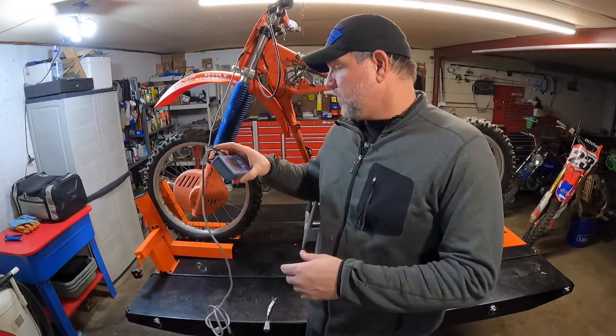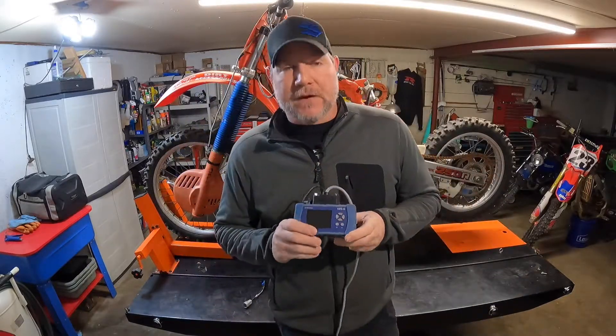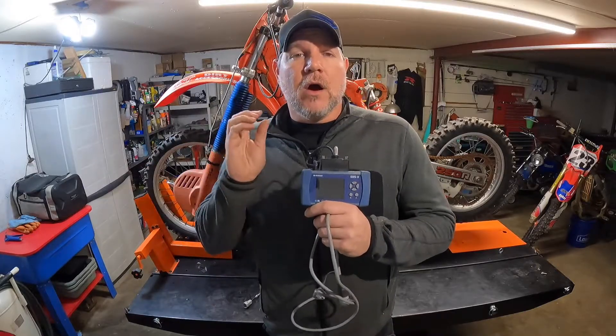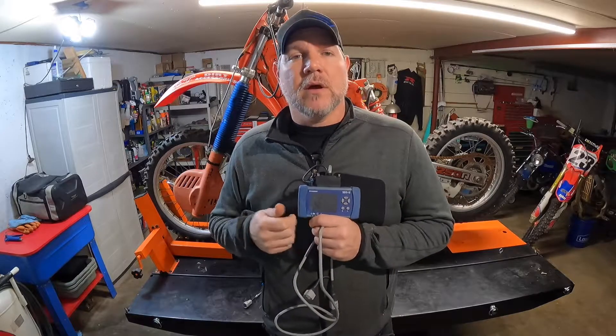Right now what I have is what is actually called the SDS2. This comes from a good friend of mine who let me shoot this video — they're a Suzuki shop out in California. Basically this tool is your factory Suzuki tool where you plug in, put the VIN numbers in, you can data stream, download your data from a known good unit to compare it to a unit that's having issues. You can also plug into your Diag plug and check all your codes and stored history codes.